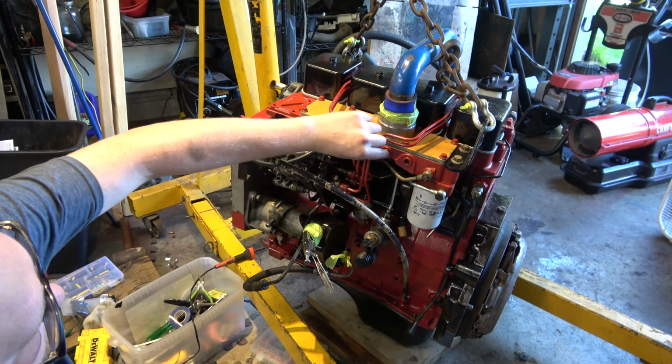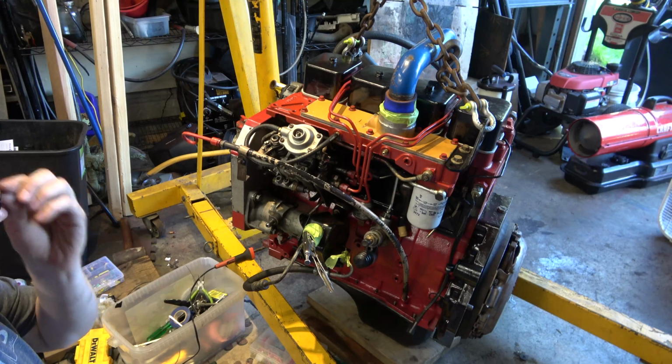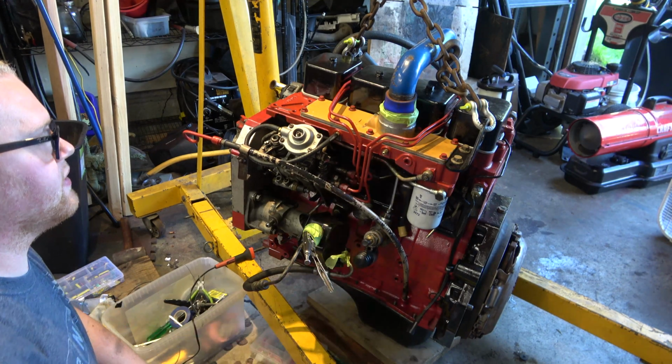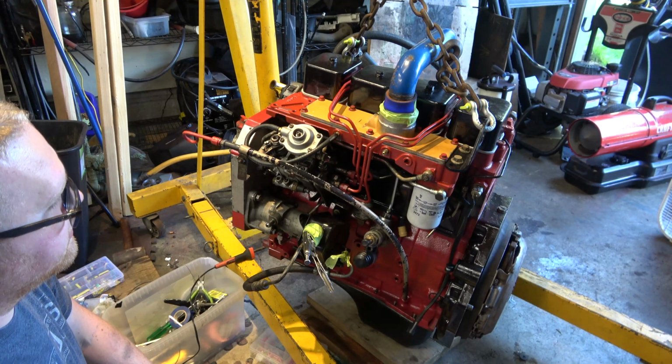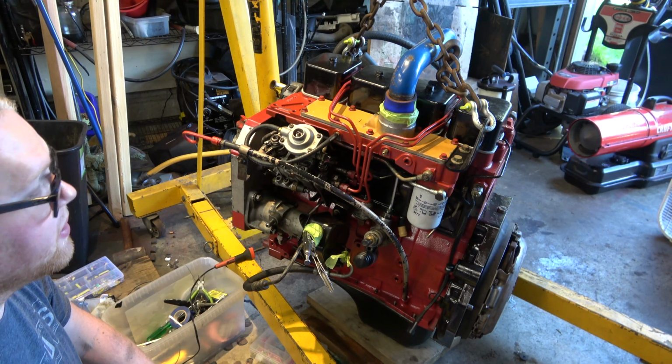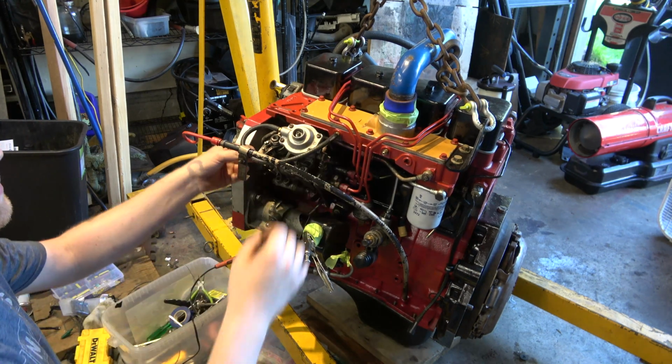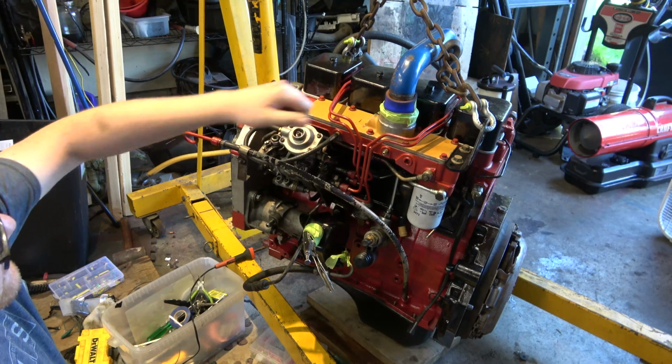Yeah, I've got to get a different fitting here for my boost gauge. We've got to hook that up. So we need to get another 1/8 inch national pipe thread hose barb, 1/4 inch hose barb. Get that in there. That's what I have here. And I got some 3/16 line over this, and that's not coming off.